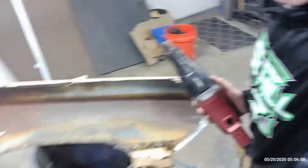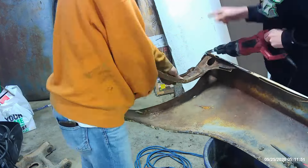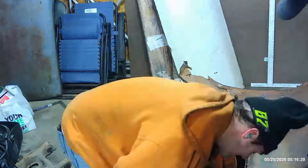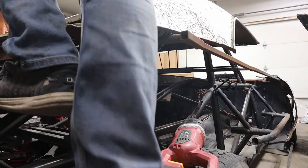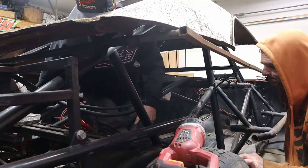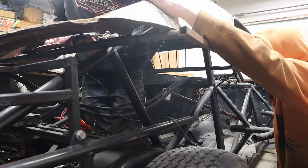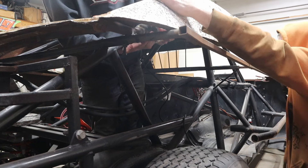Here we finally started tackling the fenders. We ended up having to cut the front part off, which lost a little strength, but we just needed to do it to make it fit. The fenders are kind of rusty but we're going to try and use most of them — we don't want to lose the Chevelle look and the fenders add a lot of that. Then here you can see me climbing inside the car to trim the roof just a little bit more. That bar I'm cutting next to — we need the roof to sit right on it to make decking easier, help doors fit better, and make the car more uniform overall.